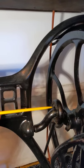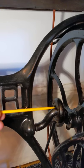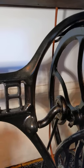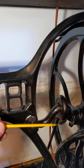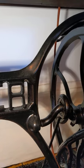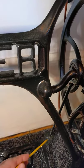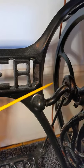Just a little blob of grease - it won't drip the way sewing machine oil does. If you put sewing machine oil in here, it will lubricate, but it will also wash out the grease that's already in there, which will cause a horrible grinding sort of noise. That oil will eventually drip out, and then you'll just have muck going all the way down your pitman rod, making it quite sticky.